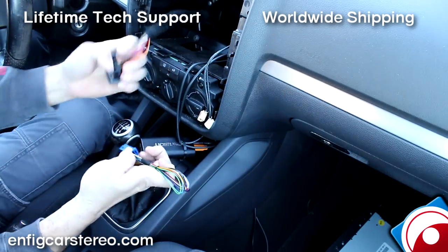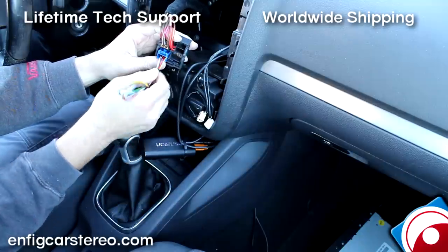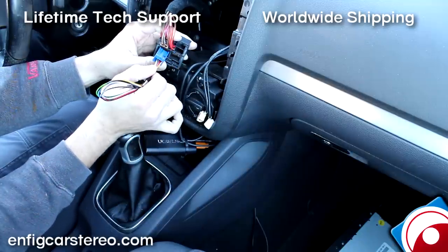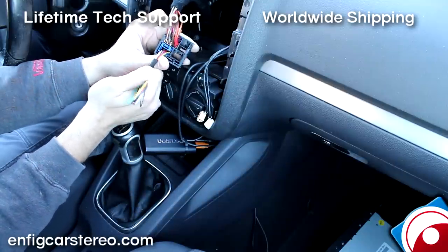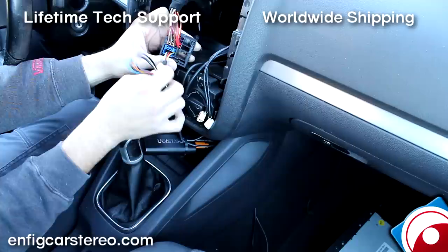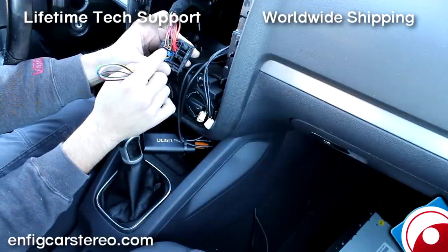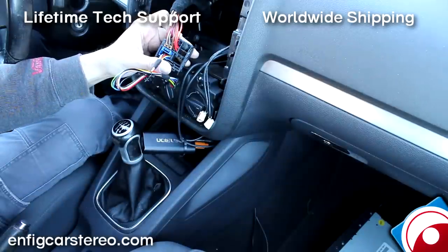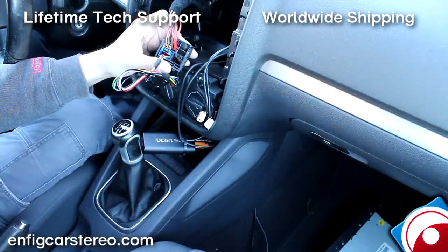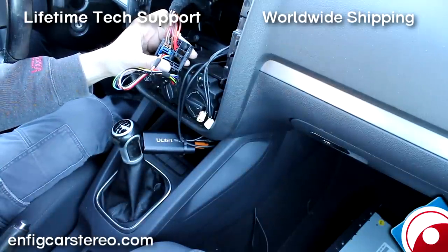Let me try to plug it into the car. In this unit there are no cables on the bottom. If there's a green connector here, that's Bluetooth — you're not going to worry about that. If there's a blue one here, it's usually for your aux, and if you have an aux, this disables it. If you have satellite radio, this also disables it — but we have a little part you can plug in between for that. The blue connector could also be your CD changer or iPod adapter in the center console. Those also get disabled. If you have satellite radio, we have a part that lets you keep it, or you can just move pins around — the part we sell is so cheap that you might as well not move the pins.